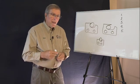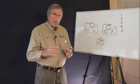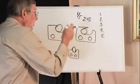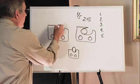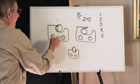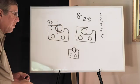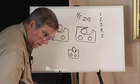But there are several situations where they might say to use this on this tooth and this on this tooth as far as size. Both chain sizes are the same, but the actual file you're going to be using might be a little bit smaller or larger in diameter. And how he explained it is 1/5, or 20%, of the cross-section or diameter of the file should actually be above the point, and we know what that is now, if it's in the proper position. If I illustrate it this way, if I were to take this into 5 parts, with 1/5 of it above that point, then you would look for a visual of 90 degrees from that point to where the file rests in the gullet area. So we're looking for a 90 degree angle. Some chains actually have a witness mark over here on the side that'll show you what that visual should be.